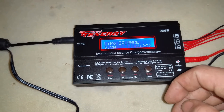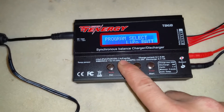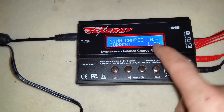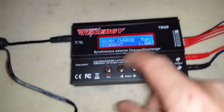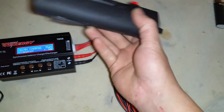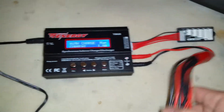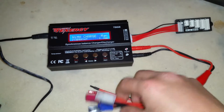The question I ran into was about NiMH charging. When you go into it, it says 'MAN' — I assumed that meant manual. So I took the 1800mAh 7.2V 6-cell pack out of one of my Traxxas nitro chargers to test it. It is 100% automatic — 'MAN' does not mean manual. I could not find that answer online or in the manual, and they were closed, but I needed to charge a battery.